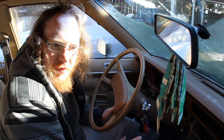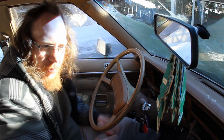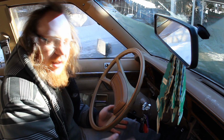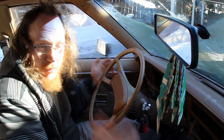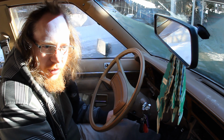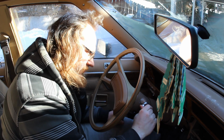Okay. There's clearly a dead cylinder in here right now. Another thing I want to point out is that when you get a new vehicle, and a vehicle especially this old, do preventative maintenance. Plugs, cables, distributor, rotor, filters. In some cases it will make a vehicle run significantly better. But again, we're dealing with a dead cold inline 6 engine. That's a lot of metal, it's got to get warm.